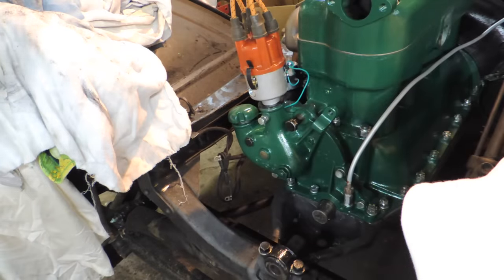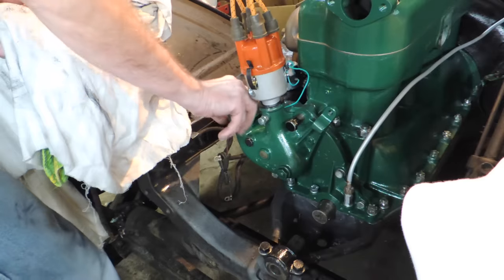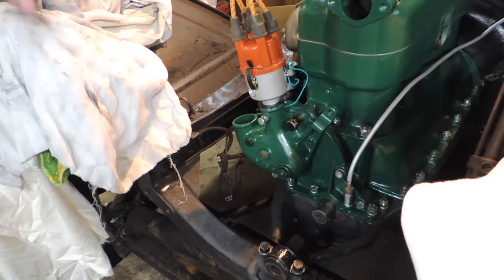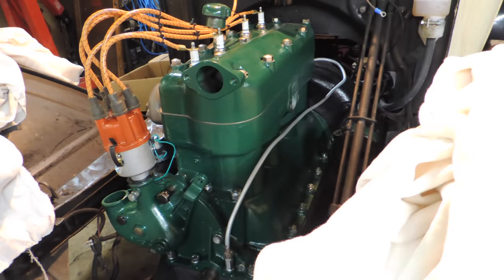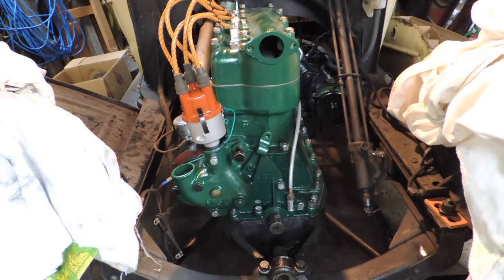All right, what else is on the list? We've got to put the pulley back on but I want to run it first just in case I need to take this off again. We're going to let the RTV harden up. I'm going to have to put oil in it, so we'll put this up here so I don't forget. I think we're ready to fire. Gas line's going to go on, I've got to turn the fuel back on. It's looking like next video we're going to start this thing up. I know I said that before but that was with a different distributor. That is how to put a Bosch front plate distributor assembly with a 009 head in a Model T.